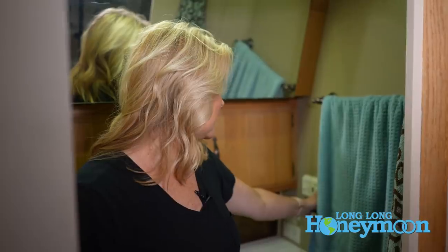The next appliance to check — and you'll really miss it if it's not working properly — is your water heater. Ours can be powered off of propane or electricity. I'm going to fire up the propane and I just heard it light. It probably takes 15 to 20 minutes to heat up, so we'll let it do its thing and come back, then give it a couple hours to cool off and check the electric. Having shore power or a generator nearby is going to be helpful in checking all these appliances.